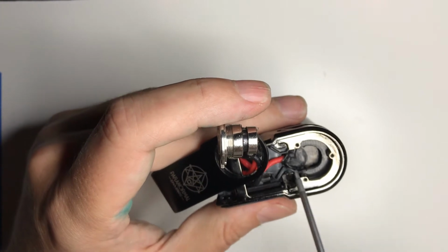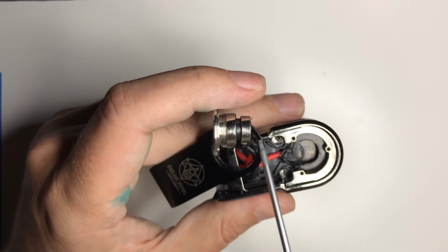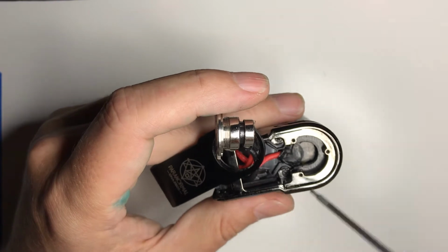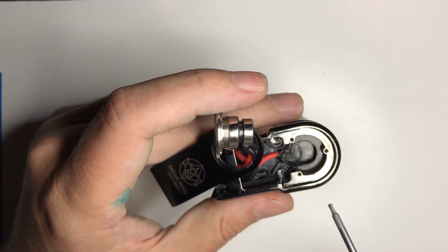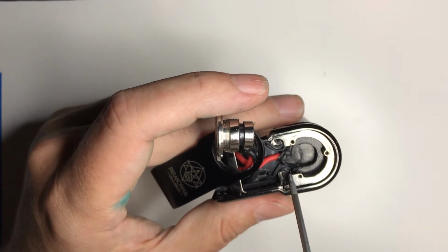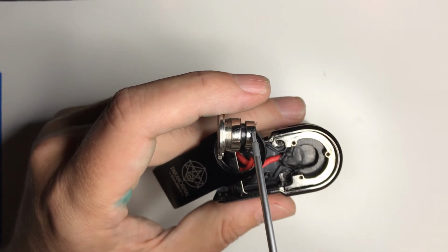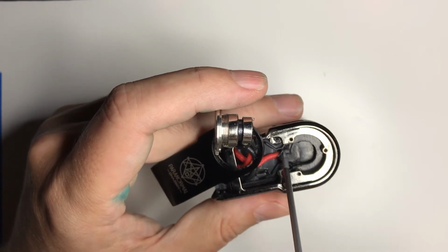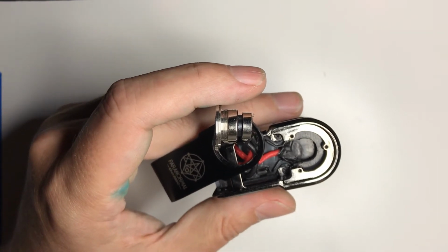I have another one, and its wire was insulated all underneath, but the way they designed this, there's a lot of things they could have done. Obviously, I just put some insulator in there and cleaned up the solder a little bit before I did that. But they could have designed this differently so that no matter how much this traveled, no matter how much bare wire was coming out, it wouldn't have completed the connection that way. It's very poor design on their part.